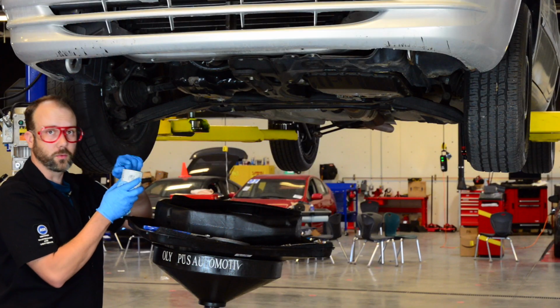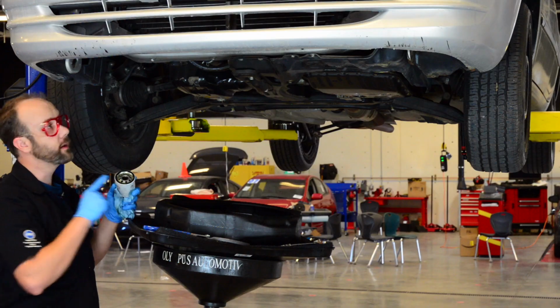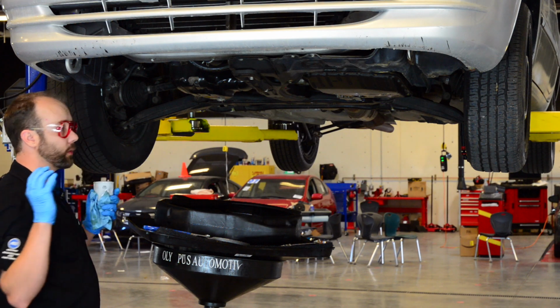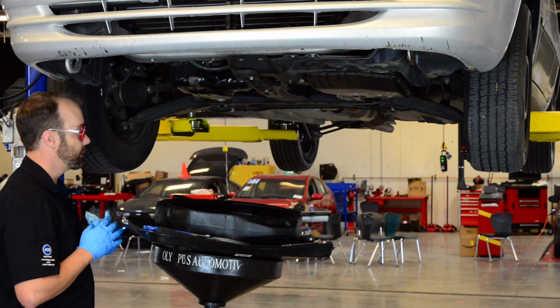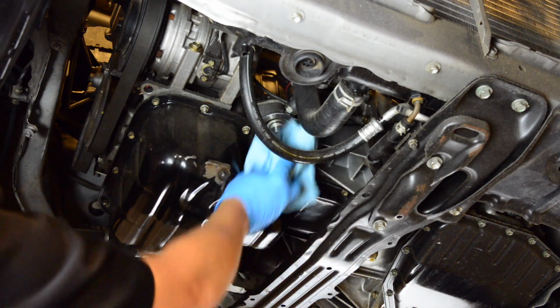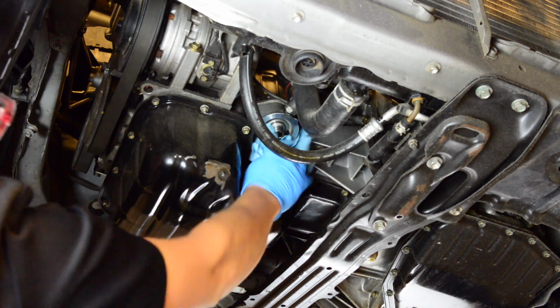The gasket is really important to make sure that it's on the oil filter. If it's not here, it's up there. And if we put 2 gaskets on, it will actually damage the vehicle by putting all the oil pressure out on the floor and possibly causing a lot of engine damage and a big mess. So make sure you take that gasket off. Then we're going to wipe up our sealing surface up on the engine.